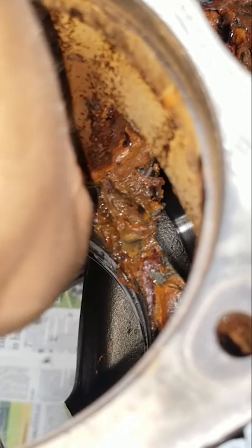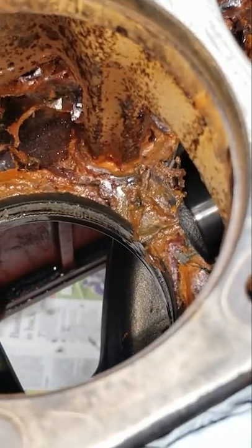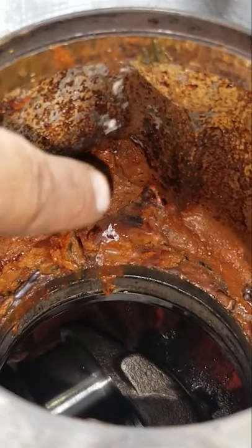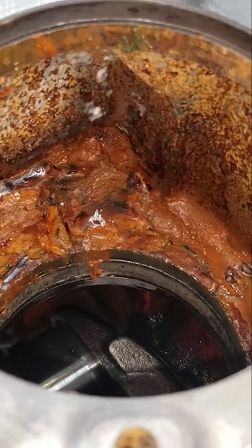What is that? It's like a flake of something. There's all kinds of stuff in here, and there's the inlet slash outlet tube for the radiator. It would have sucked all this stuff through the radiator and water pump and just destroyed everything.